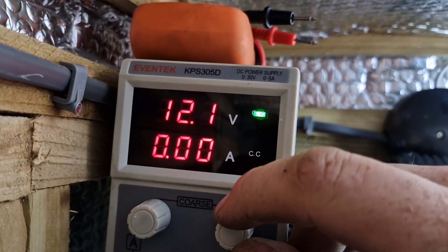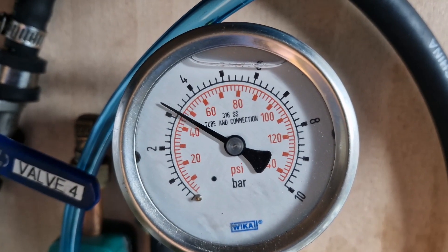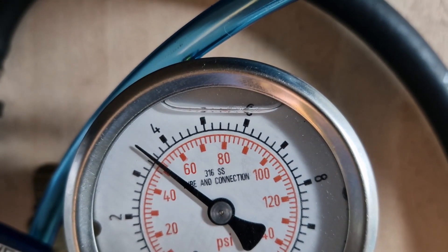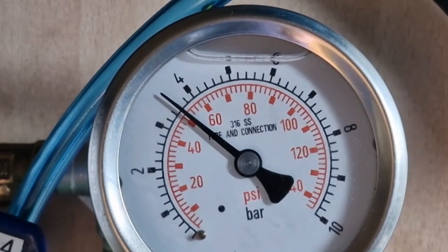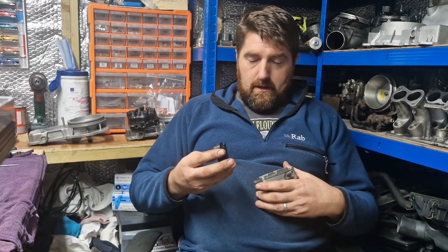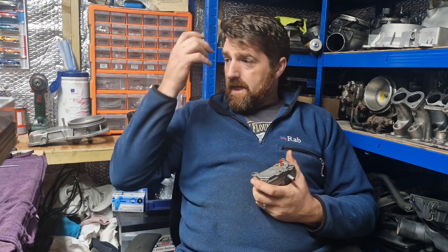For the non-vacuum type: bang it on 12.5 volts stone cold, get the heating element plugged in, let it warm up — we're at 3.5 bar. Whack that up to 14.5 volts, let it warm up fully — we're at 3.6 bar. So that's 0.1 bar difference. Excuse my earlier mistake of saying half a bar. 0.1 bar doesn't sound like much, but it's a lot of difference when you're trying to get close to spot on. That's 12.5 to 14.5 volts — 0.1 bar can make a difference.